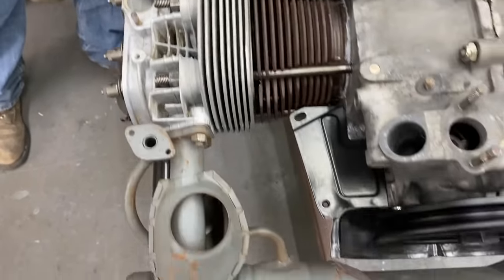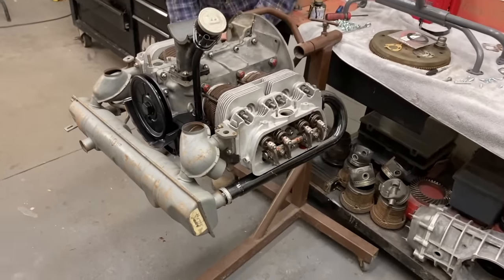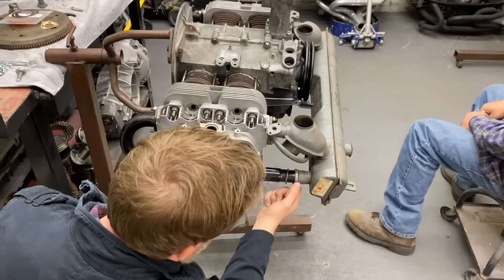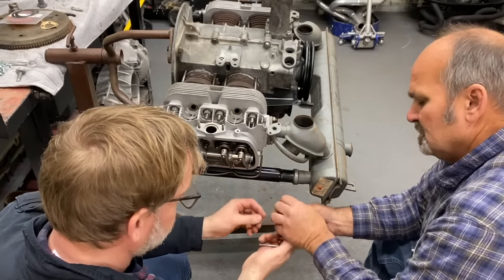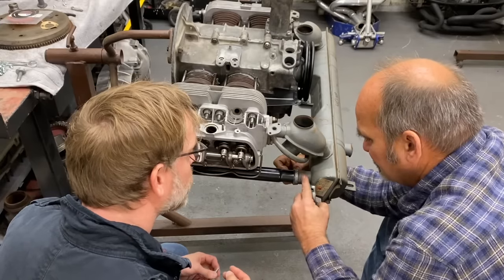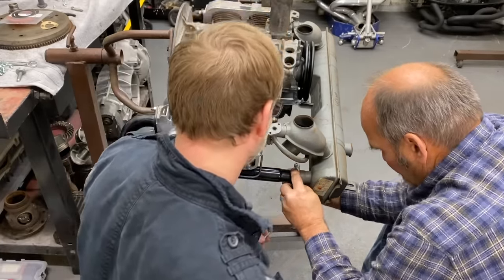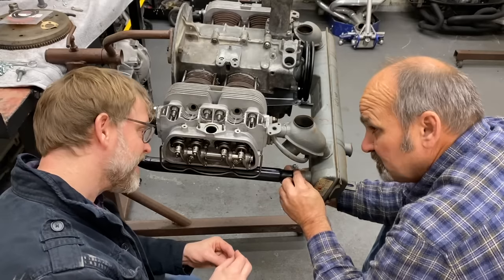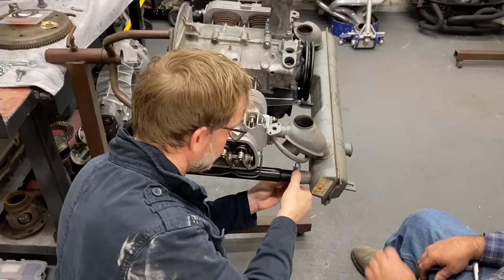So the J-tubes are on, the exhaust is on. There we go. Torque goes on the nut side. Basically I'm gonna show you how it goes. Pull this like this, and then you want to place your clamp like so. You want to capture that metal piece and this lip on the muffler. I'm gonna bring that over like that. And you want to make sure, in case Scooter's watching, that these are straight and the bolts are symmetrical, not tightened on one side. Equal length.